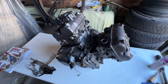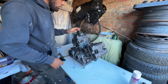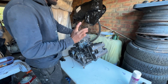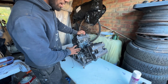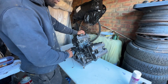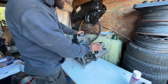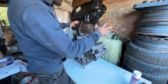The bolts are ready to go. I'm going to grab the frame and bolt it on. Another thing I did is install a new neutral switch, because on my other bike the neutral switch failed on me. This bike has been sitting outside for 16 years, so I've replaced the neutral switch. Hopefully that should negate any electrical issues as far as starting up goes. I'm going to grab the frame now and see if we can drop it on here.